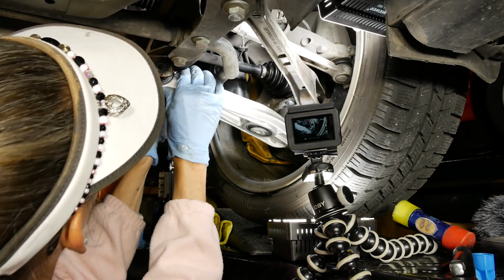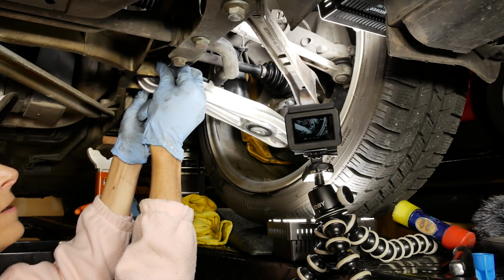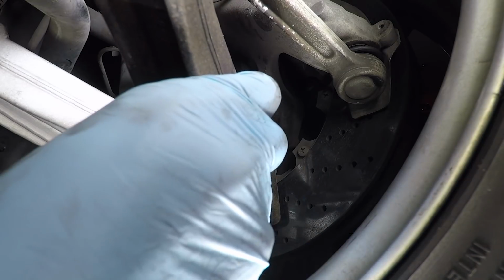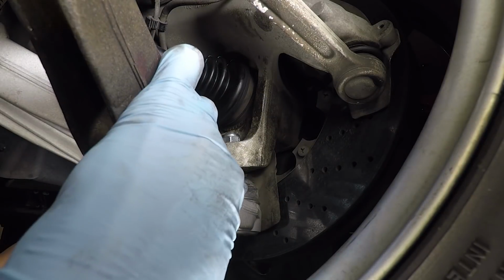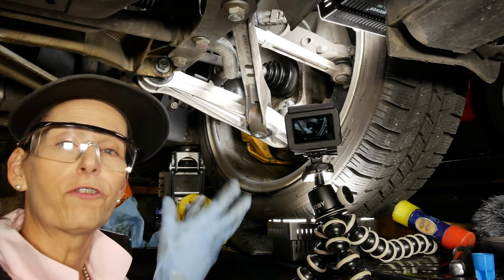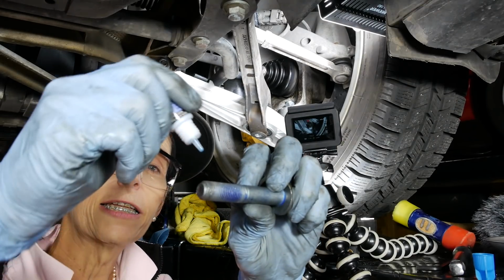Fit our bolt back in. There we go. Got our nut here. That looks good. To get our tuning fork in place as well. It's important when you're doing these sorts of assemblies to leave everything good and loose, because if it's super tight, you tighten one thing, you'll never get everything else on. So everything's still good and loose so we can move everything together. So we're going to add some blue Loctite to this as well.